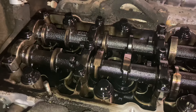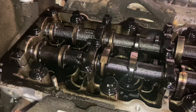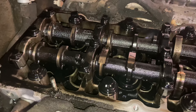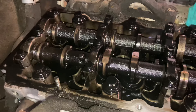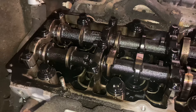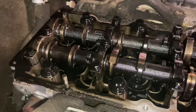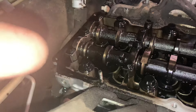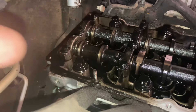What I'm recommending for anyone that's going to do an injector replacement job on their Hilux, or even their Prado for that matter — just happens to be the Hiluxes, they were ex-mine vehicles — start spraying some CRC, some Inox, any of this sort of product you've got on that bolt thread there.